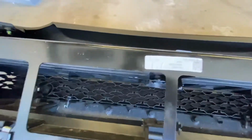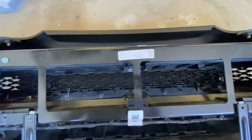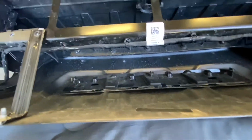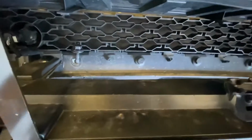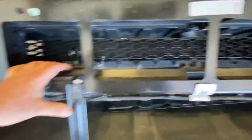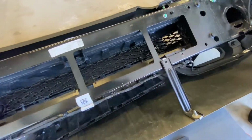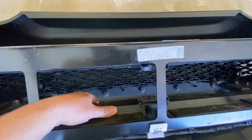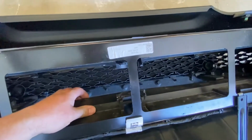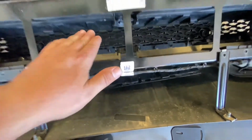Then additionally, the light bar does not fit in through this one way or the other, so it has to go from the bottom. In order to do that, we had to cut out this piece of plastic here from the inner shroud, basically giving us some access from the bottom. After that, we've got 1, 2, 3, 4 10mm screws, which loosens up this plastic piece, which hopefully will give us enough room to bring the light bar in from the bottom, in and back.